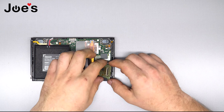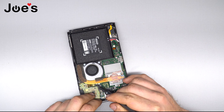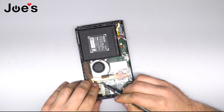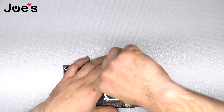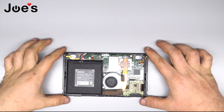Now we can grab a replacement. Slide it in the same way we took the old one out, and it'll slot right in. We're going to have to align this — if you look at it through an angle, you'll see it has to line up with the port, so you may need to move it over a little bit inside. Once you see that alignment, just press down and you'll hear it click into place. Now we can screw the heat sink back into place, align the screws. Reconnecting that clip is not a necessary step, but I like it for a bit more room.